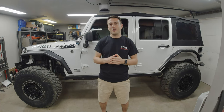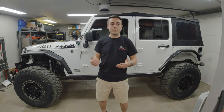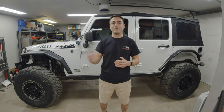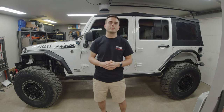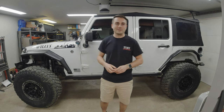For on-road performance, I was extremely surprised with how quiet and soft the compound was initially. They weren't as soft as a sticky or red-label tire, but still quite impressive. Over 30,000 miles they have gotten a little louder, but they're still not nearly as loud as the lifted trucks running 35s or 37s you hear on the highway. I've been very happy with how minimal that noise has been with the Firestone Destination MT2s.